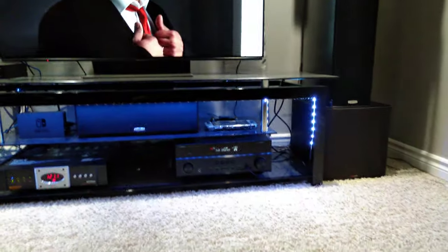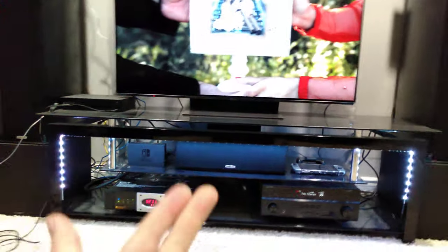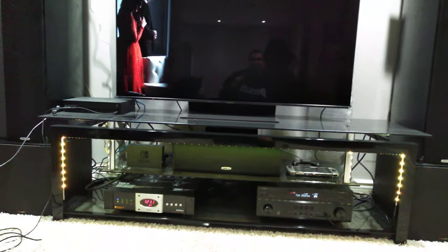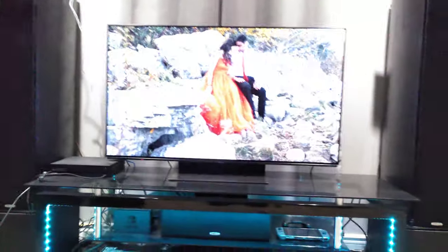So that's just showing you an example: if you have a newer TV and an old amplifier, you're going to have to use two separate cables — one HDMI and one fiber optic cable. You're back to square one unless you update to a brand new amp that has eARC, and your TV also has eARC, which this TV does.